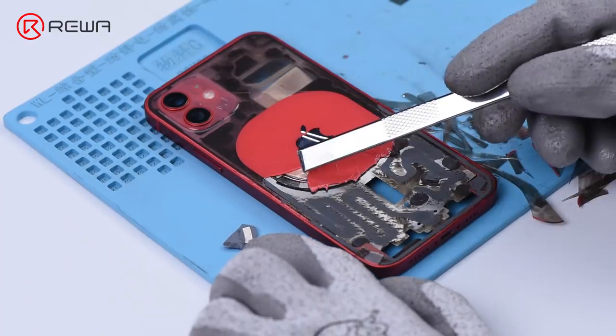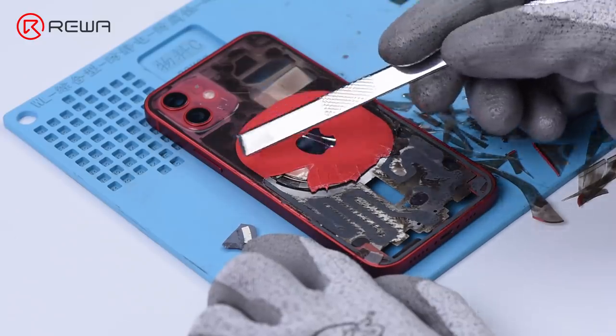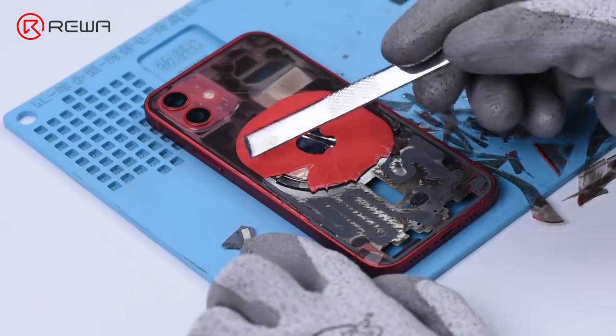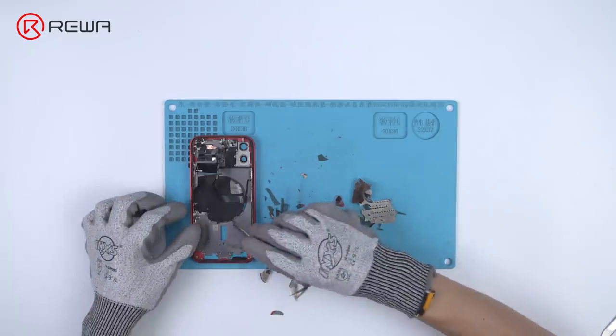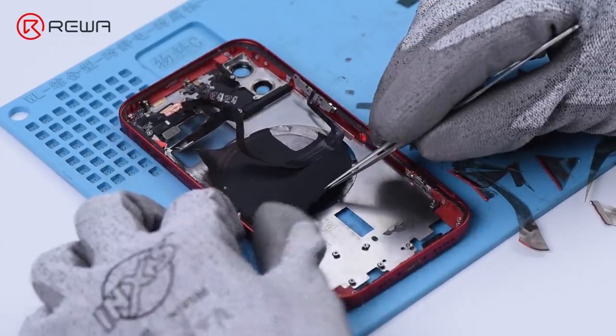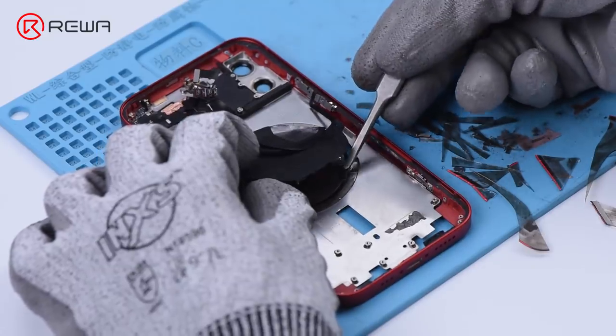Because the magnets are glued to the back glass, the iPhone 11 back glass fixed solution is not suitable for iPhone 12. If we stick to the old method, all magnets will fall off and become separate, making the subsequent recovery process harder. In addition, we can't mark the wireless charging area directly with a laser to avoid damage — we should remove the wireless charging coil first and then mark.